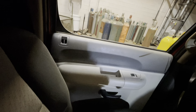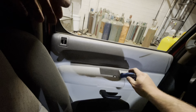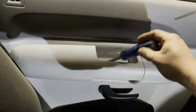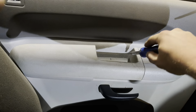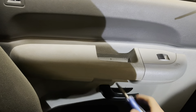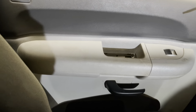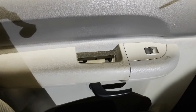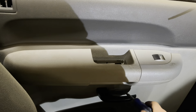We'll go ahead and do the fasteners. There's, I think, three total if I remember correctly. There's one under this panel here — just pop this little guy out. There are two in there; they're kind of recessed in but there's one there and one there. Ten millimeters. Then you've got one down here below the door handle — go ahead and just pop that guy out.